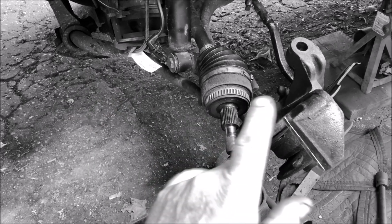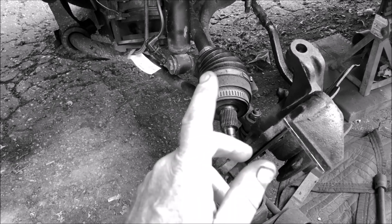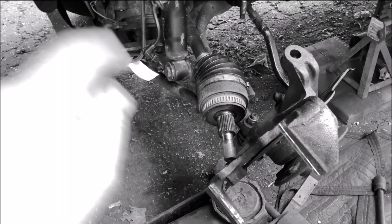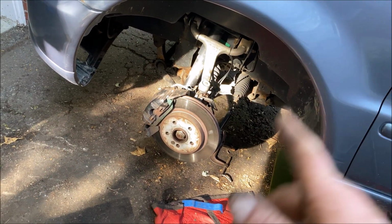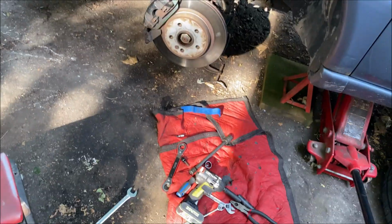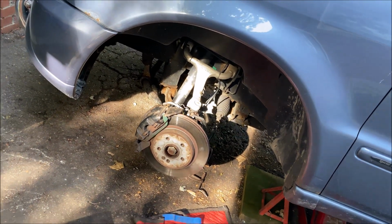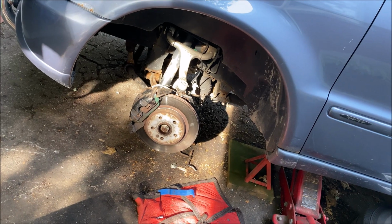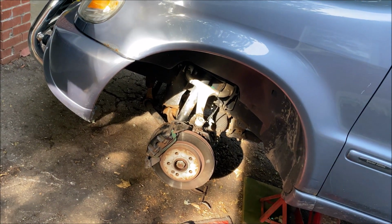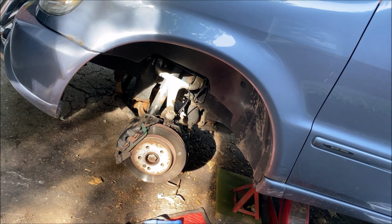And the center axle nut, we'll come back to that when I get ready to do that, which will be about 5 minutes from here. But I'm going to put all those back on, torque them, and then we'll go to the center axle nut, which is the toughie. Things backed on and torqued up, and I put the center nut, I'd say it's around 250, 300 foot-pounds with my impact gun, but it's supposed to be 360 according to the factory specs. 360 foot-pounds is a lot. I do not have a torque wrench that goes up to 360 foot-pounds. Mine goes up to 250. So most people probably don't have one.